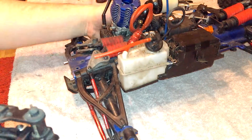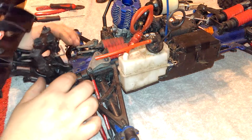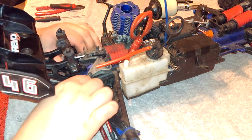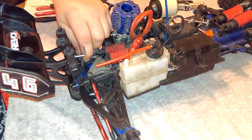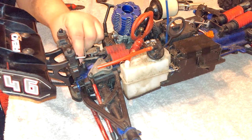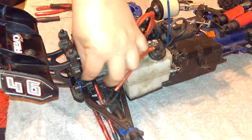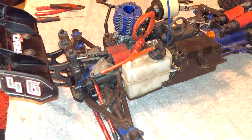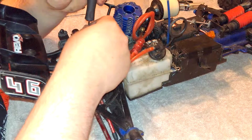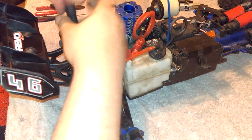Right, now reach back over for your truck, pop that in place just there, slide the rear mount back into position, pop your 3 bolts in place, like that. Now, go on your driver, and tighten them up.